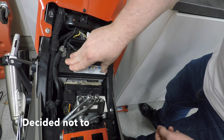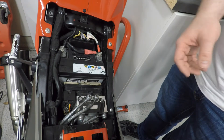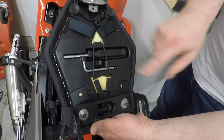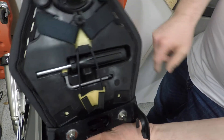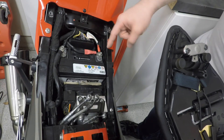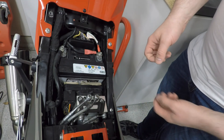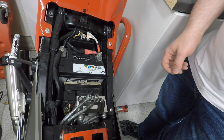This battery is now really in there and you can't end up with loose bolts or loose screws. Now if this happens to you when you're on the road and you still have the original pillion seat, this Allen key or Torx key will help you get the seat off to get to those two bolts. There's a screwdriver here which will allow you to tighten up these screws enough for you to get home, then get a proper socket wrench on it and do them up properly. See if you can find something to wedge in.